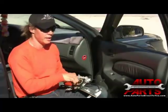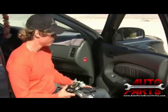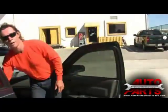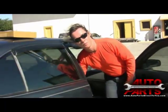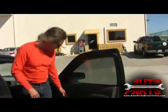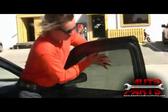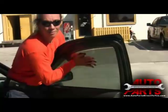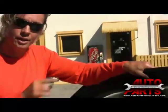First thing you want to do is run another power window so you know the door lock is off — it's kind of silly, but people forget that. Now we can hear this motor spinning inside, but the glass isn't moving. With my hands, I can move the window. So the mechanical link between the glass and the motor is broken. This is a mechanical repair, not an electrical one. We're going to take the door panel off and diagnose further — it could be a gear on the motor, or it could be the regulator.